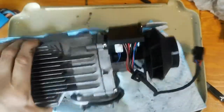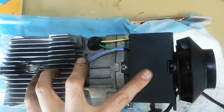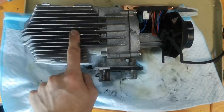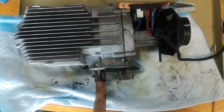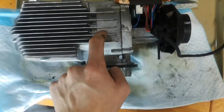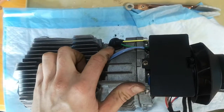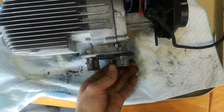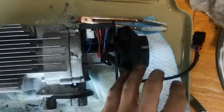A little bit of messing around but it's finally all back together. There's the glow plug, there's the temperature sensor, that's the control board. Inside here is the burn chamber — that's the burner inside there. There's the exhaust, and this here is the fuel pickup which goes up into the burner and drops a little bit of fuel down into the small burn chamber where the wire gauze atomizes it. The glow plug in there heats it up and burns it — only on startup though, until it gets enough heat to burn on its own.